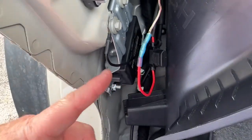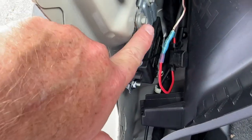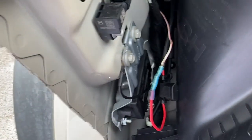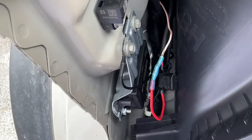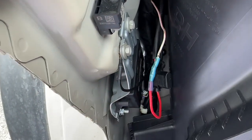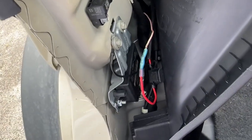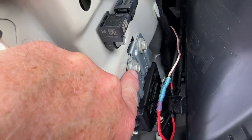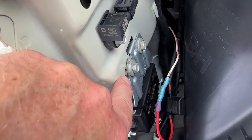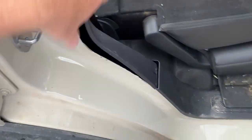This wiring bundle I used — some of the lights had ring connections for a ground, so I just grounded it right there on the seat belt connection. I left the inline fuse on it, you can take it off if you want but I left it on. To ground it there, just remove that bolt — it's a 10-millimeter bolt. Pull that bolt out, put your round ground connector on, and fasten it back down.